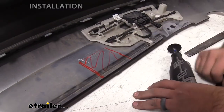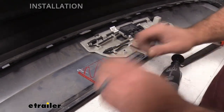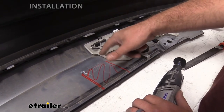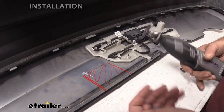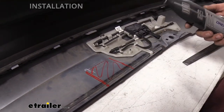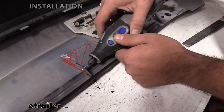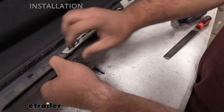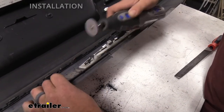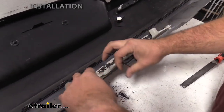Next, trim the rear fascia to make room for the hitch receiver. Mark out the cut lines using the dimensions in the instructions. Work from the inside rather than the bottom to avoid contacting the liftgate assist. Use a hacksaw or rotary tool — a rotary tool makes it easy to zip through. Wear safety glasses while cutting. Trim the small extra lip as well; the piece should come out easily. Then use a file to remove any burrs, leaving a clean edge before reinstalling.